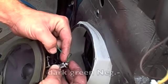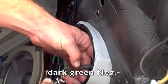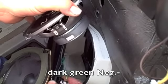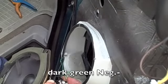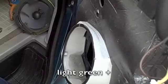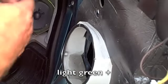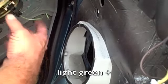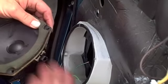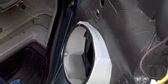So as of right now, the dark green is going to be our negative terminal. When we go to look at the wire, we're going to connect the dark green to the negative terminal on the new speaker, and the positive is going to be the light green. I'll also include a wiring diagram so you can see the factory wiring from there as well. This way you can test it on any speaker, any system — all you need is enough wire on the back of your speaker to test the polarity and find out which direction the speaker is moving. Out of phase is in reverse; in phase is forward, coming out first.